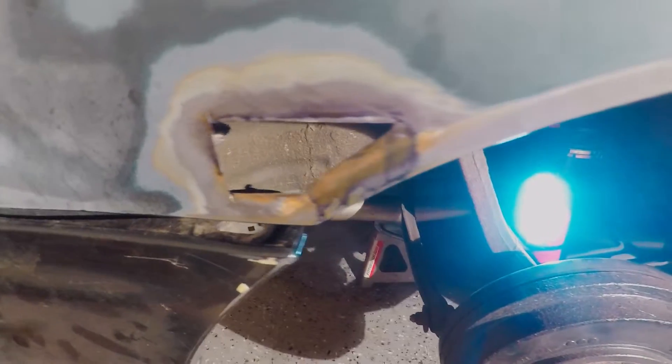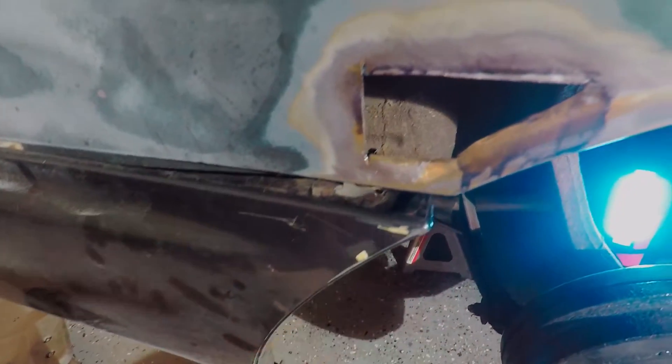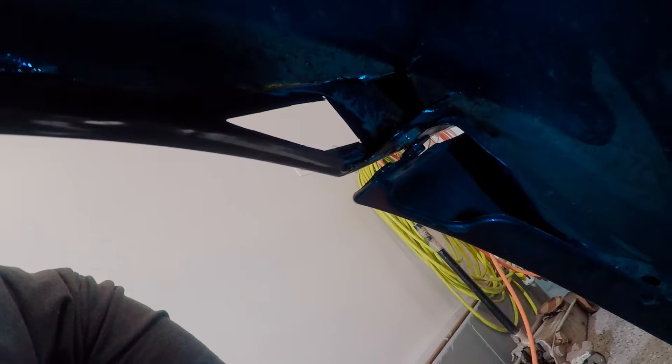You can see out here there's some kind of reaction going on, looks a little like rust, but we'll grind that off. Looking inside it's getting pretty black in there, which is good - it means all that rust has been converted to an inert material that's no longer going to corrode, which is exactly what we want. I'm going to wait a little while longer, spray another coat, let it sit for 24 hours, then regrind a little section and panel bond that piece in. After I prime in there I can start fabricating the piece for the back.